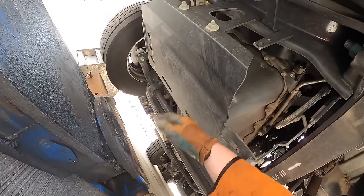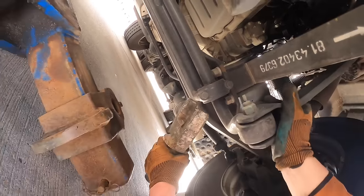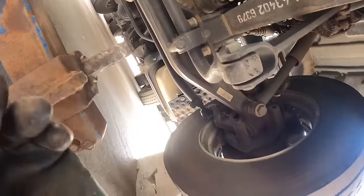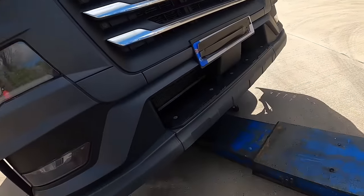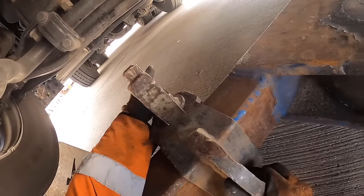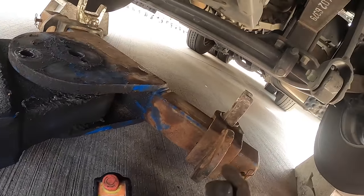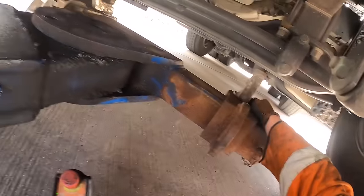Here we are underneath the MAN. Metal guard to protect the sump. Got some forks — get them right up in that corner, there you go, lovely up in there. Right to the end, slide in. Quite a nice looking truck — new grill on that they've gone with now. Unfortunately the electric handbrake, but they're not too bad compared to the Mercedes, which can be a bit of the devil to get off. The procedure is quite straightforward on the MAN, same as the Scania and the Volvos.